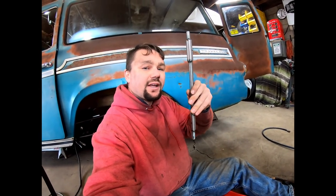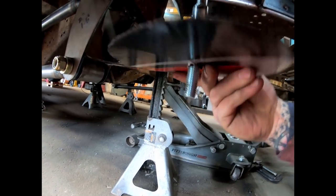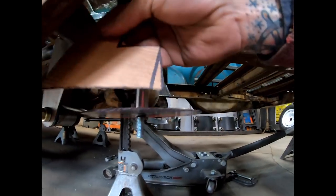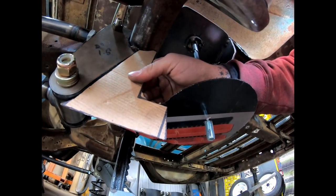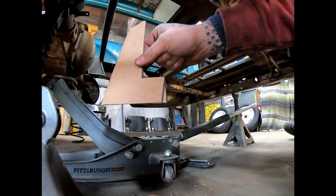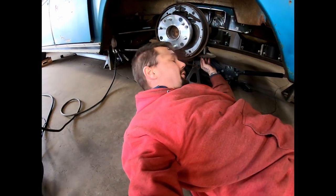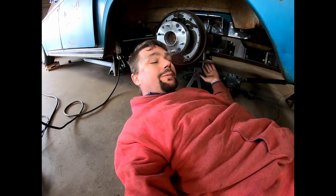I'll take this piece, put it up through the top plate and thread it on. For the bottom mount template: it's going to go up in there, broken at an angle, and sit like that. I have little gussets figured out that will go up in there as well. Because one side is flat and longer, that template gets an additional three inches of material. Off the bottom I'll cut a piece of pipe that sits down on there. It's nothing real elaborate — just cutting stuff out with the plasma and cleaning it up, plus cutting a piece of pipe all the way around with a cutoff wheel.